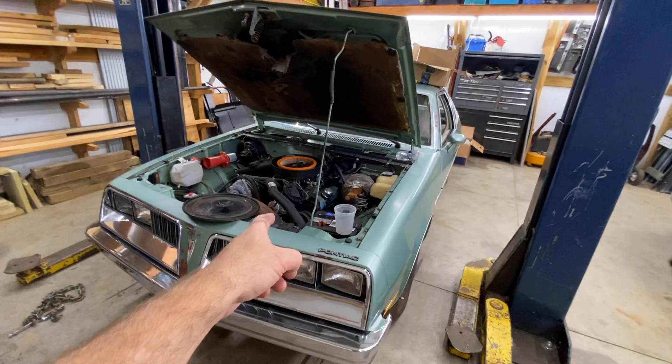Quick recap: I've got everything disconnected up front. All I've got left to disconnect is the motor mounts, transmission mount, speedometer cable, shifter linkage, drive shaft, and exhaust — that's it. The motor is assembled. We had to modify the alternator bracket — this is a stock V8 Monza with air conditioning. The alternator bracket had a boss for the smog pump, but I don't have a smog pump, so we nipped it off. It was right against the water neck.